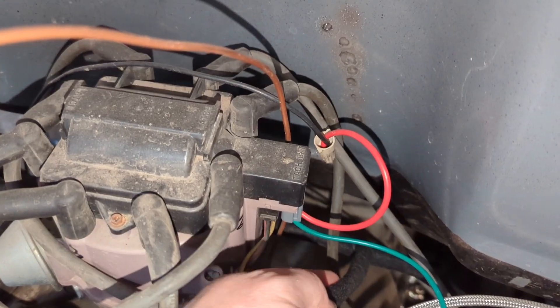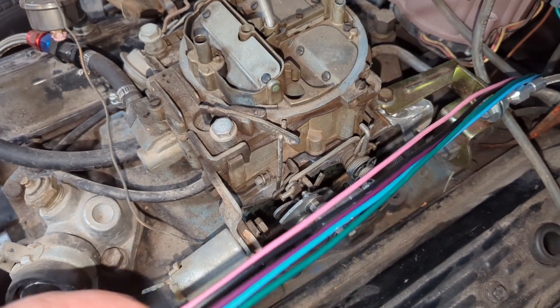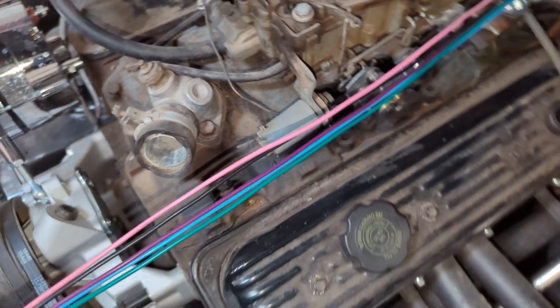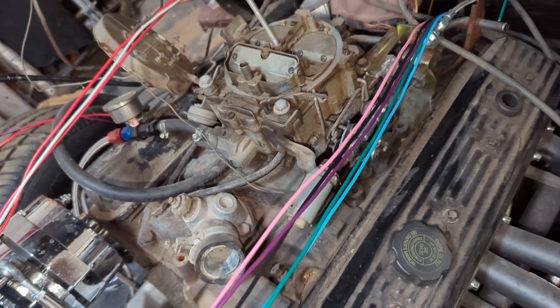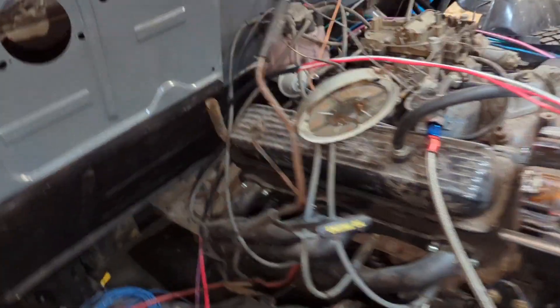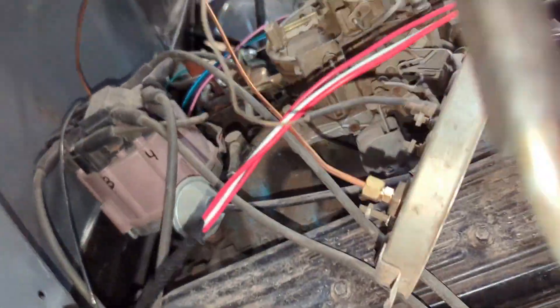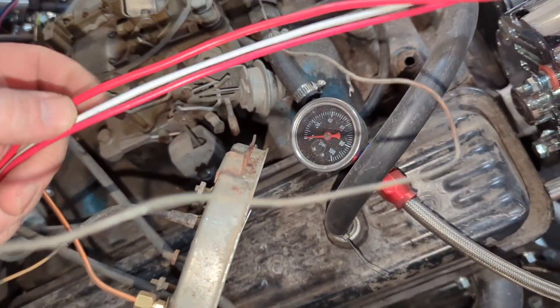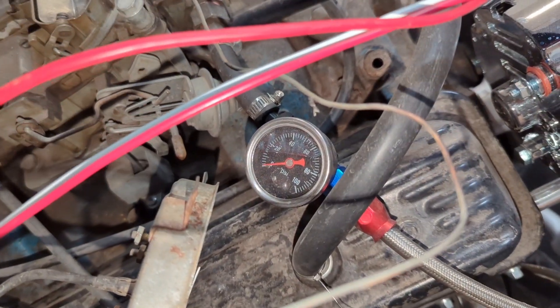I went across. I wrapped this up — you can see how I wrapped it here — and then pulled out each one of the wires that comes up here. I've got my tach, my AC compressor I think is in here, because eventually if I get AC I'm going to have to put it right there. Oil sending unit and the ignition to go to that HEI. This side I've taped it here, made it look semi-presentable, since the rest of the engine looks like crap.